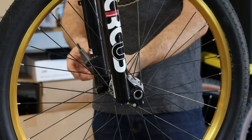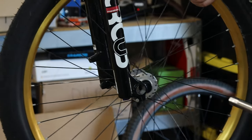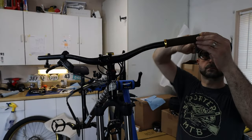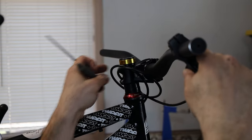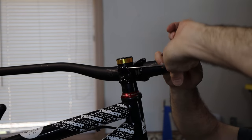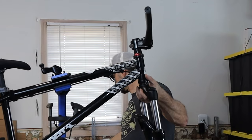The first task was to replace the headset bearings which were sticking. I had assumed that maybe the head tube had ovalled out. This is a phenomenon where over time the head tube develops an oval shape. This usually happens when a bike is ridden with a loose headset for an extended period of time. It isn't really a common problem these days, but after a little research, I learned that the bike had the wrong headset bearing.